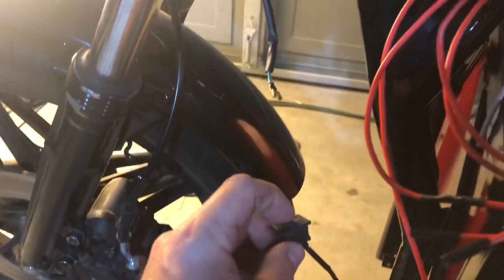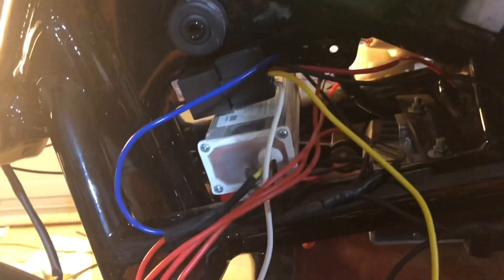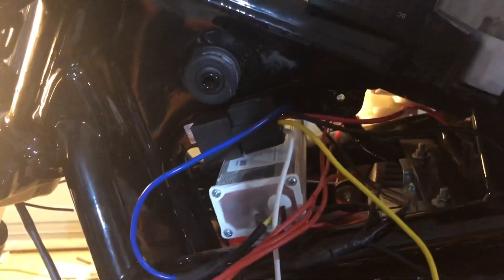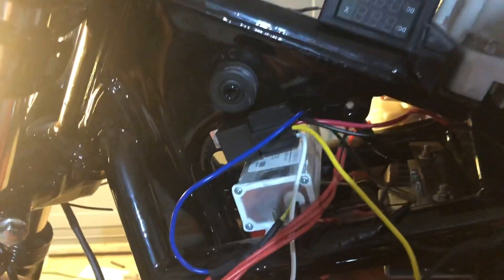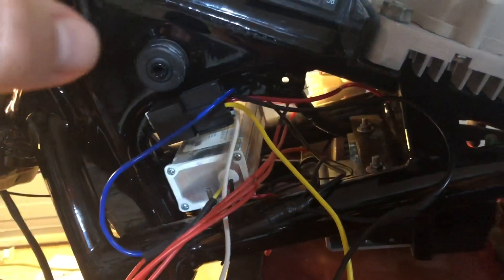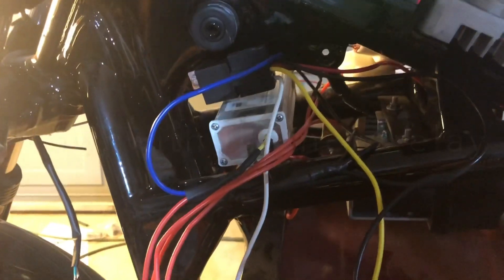What that means now is when you turn this switch - and I might even try to install the other switch tonight - everything's dead until I turn this. Now even the display is connected to this, but previously that was connected straight to the DC-to-DC converter. The benefit now is we can run a higher current because we're running through this relay. So we can run the headlights, and when we turn the key on it's going to activate all the systems. Your controls on the handlebar will work, but we don't have any wasted power - nothing's drawing energy until you flip this switch on. Big improvement.